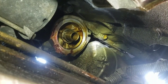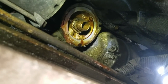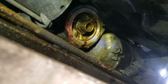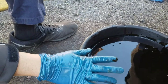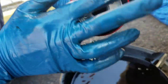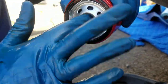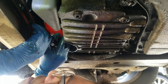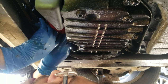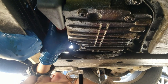Underneath the car, here's where the oil filter screws in — make sure it's clean and the old gasket isn't stuck there. If it is, you could blow your engine: as soon as it gets oil pressure it'll blow the second gasket out, all your oil will leak out, and you won't even know it. When installing the new filter, dip your finger in old oil and rub it along the gasket — it'll make removal much easier next time. Screw it in until it stops, then go another quarter to half turn, just hand tight.